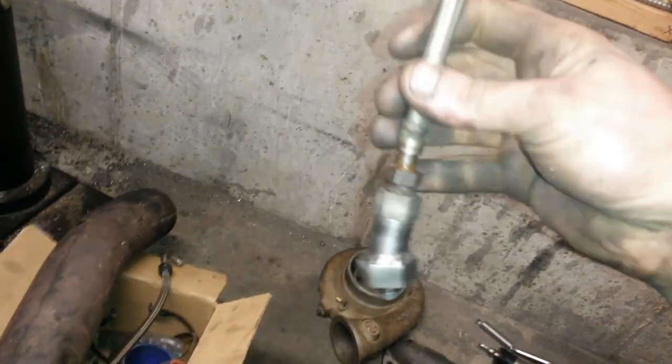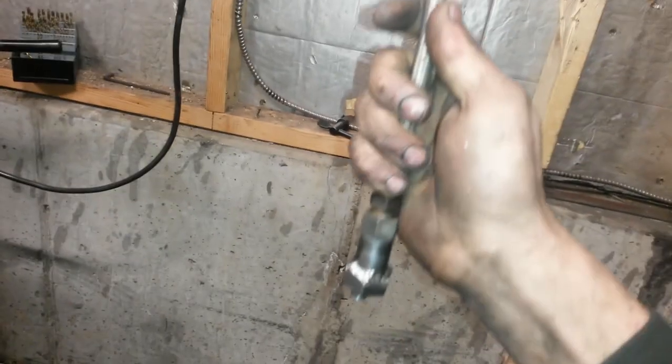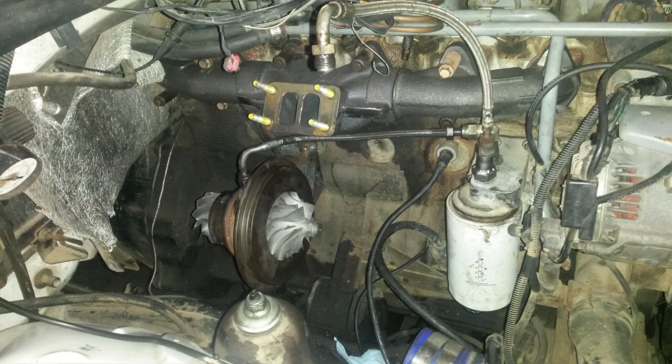And then this is the stock turbo feed line. That one feeds this primary, by the way. This one feeds a secondary, the HX35. This is the stock HX35 feed line. But we did make our own special fitting there because this one goes in the 1/8 inch NPT port, and the port's kind of at an angle. Not that severe, but instead of going straight up, it's kind of like that. And so that would shoot the oil line at the interstage pipe. So we made an elbow there that offsets it so it's straight. It also brings it up a bit because this guy would be too short, which is why you have to get rid of him. So basically, it extends the line and puts it at the right angle so it shoots the oil in the right direction. So all the Gucci sauce there.